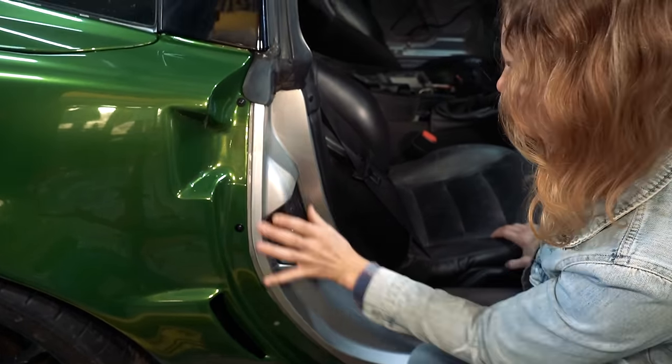The inlays, well, not the inlays, but the back part of these vents, it was so hard to get the little bits of vinyl that have to wrap around to stick. Because, well, we know the inside of these fenders is that raw fiberglass, so I went and got some duct tape, and I'm tacking the duct tape to the end of my vinyl, and I'm warming it, and then I'm pulling it, and the duct tape is seeming to stick on the backside of these fenders. So that's what I'm doing. I can't say I'm proud of myself, but I can't get in here to get that adhesion promoter on the backside of this fender because it's already mounted. All that to say, let's do this.